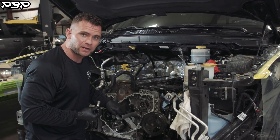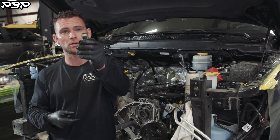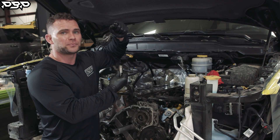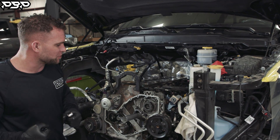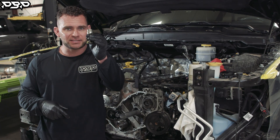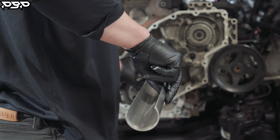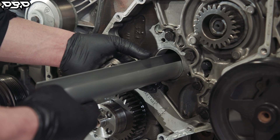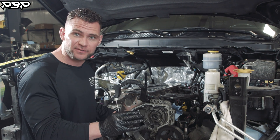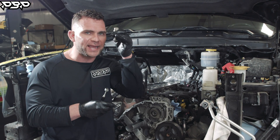You're not ready to pull the camshaft out yet. There's a trough here — it's got to catch something, which is the lifter falling into it. With the hydraulic roller lifter, we've got to put a magnet in these 12 slots to hold these lifters up, then pull the camshaft out. We're going to the first cylinder to make this make sense. You guys are seeing the trough go in where the camshaft is — we are starting from a factory point with the factory cam installed.